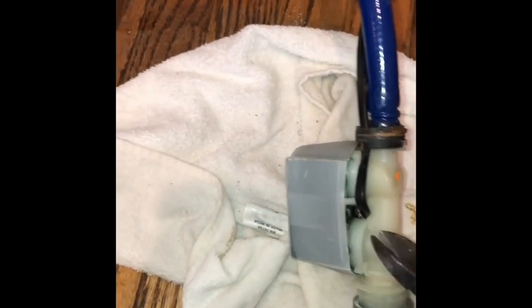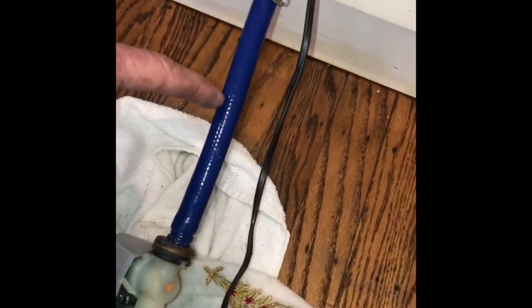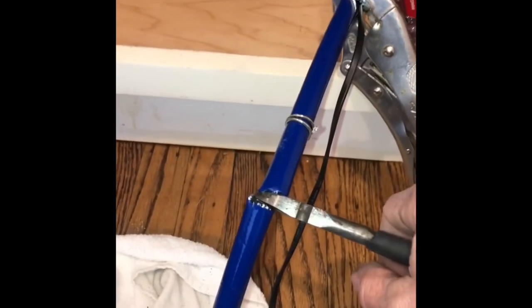Now use pliers to move this hose clamp back about 10 inches. And make sure it's unplugged. And then I'm going to use my dykes to cut the wire connector right here near the solenoids. And I'll pull that through. And that's going to be the power that I'll use to power up the new fill valve. I'm going to measure about 8 inches away, and I'll cut through the tube using my diagonal pliers or dykes. I'll snip through that tube. You can use a razor knife too.